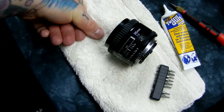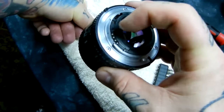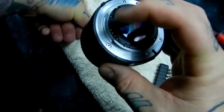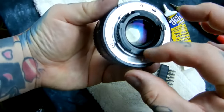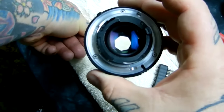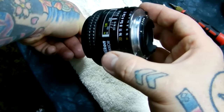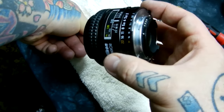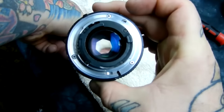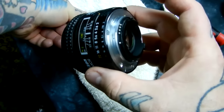After fixing it, I thought I'd show you what's inside. There's nothing in here other than a set of gears. There's a little microchip underneath these CPU contacts that tells the camera what lens is on it — that's easily replaceable. Remove these three screws, lift it up, and there's a flexible circuit board underneath. Lenses that came after these have internal motors, then later silent wave motors, and even more motors to drive vibration reduction.